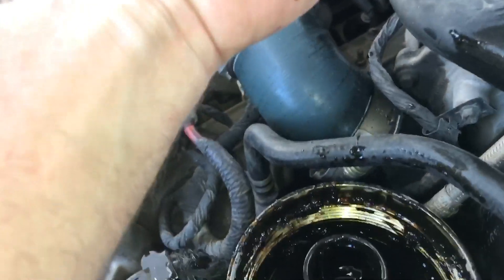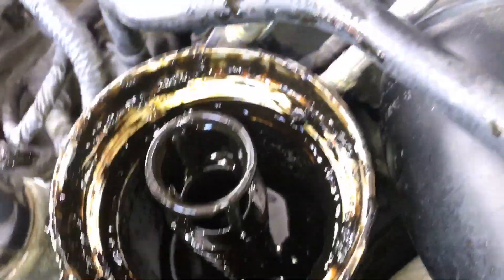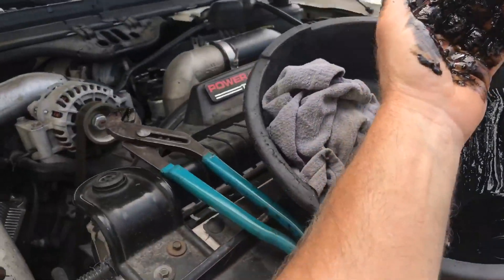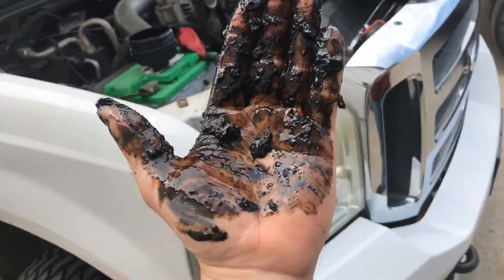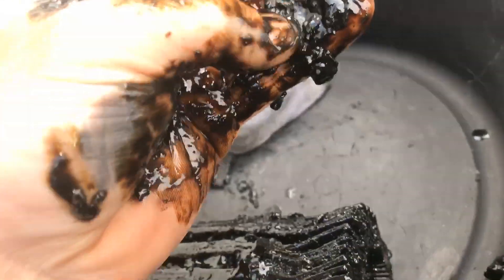It might be like a cracked front cover or something. I haven't even checked the drain pan — let's hope not. The plug's not in, but it's not even draining out — it's low. I bet the turbo's fried if that's the case. Lifters are probably shot because they've been starved for oil. Turbo seals are probably shot too. When we put oil in and get it pumping, it's probably going to need a turbo. It's not a good sign that there's two jugs of coolant in the back.